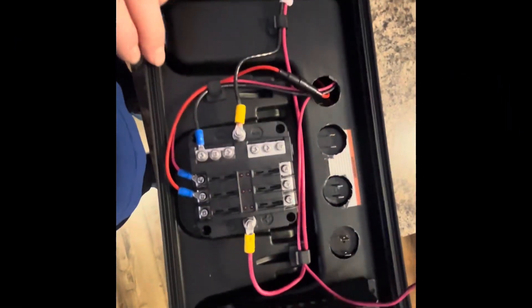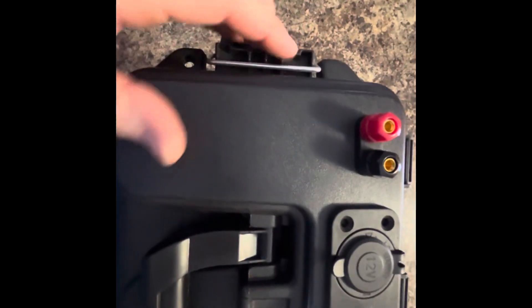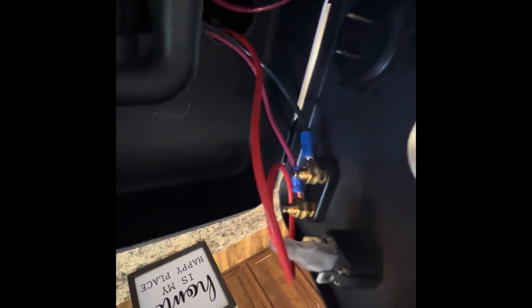So that's part of what the inside looks like so far. We're going to flip this guy back over and close him up, and let's show you what we've got going on here. I'm trying to do some of the wiring, as you can see. There's the switches. That red lead there is going to the — coming from the fuse block, my bad. And there's the banana jacks for the constant 12 volt. Here's all the plugs for the USBs. This is going to the solar charger.